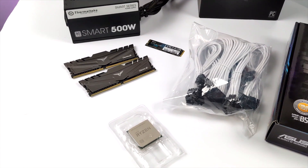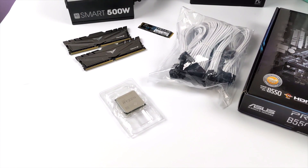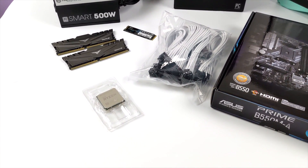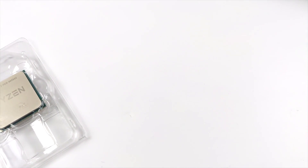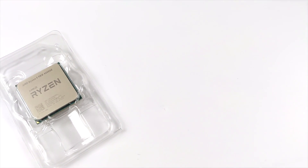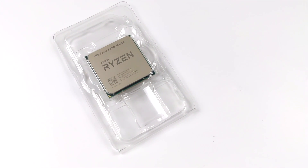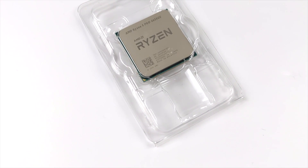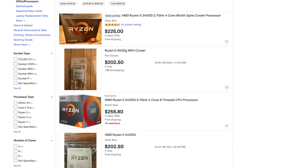I'm super excited about this. I will be going over the parts as we start the build, and I'll list them in the description so you can see what was used. But let's jump right into it with the main bread and butter of this whole build — that's the APU. For this one we're actually going with the Ryzen 5 4650G. These are about $250 on eBay, and some of them do include a Wraith cooler. And I know it's a bit more than a lot of people want to spend on an APU, but even if you were to look at the 3400G right now, this is not far off from that price given the PC parts climate we're in right now.